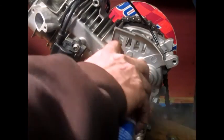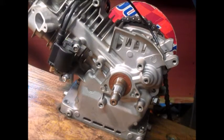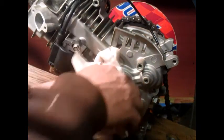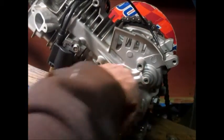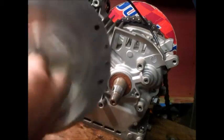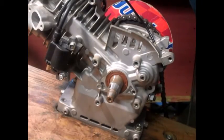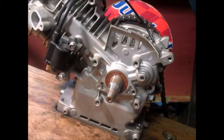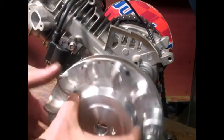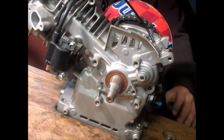So you've got it lapped — now clean it off really well with a nice clean rag. You want to make sure you get all that lapping compound off there. You can see it's shiny — cleaned up pretty well, cleaned inside the flywheel too. Get as much out as you can; you might have to do this process two or three times. No key — get rid of your key. So now I have to go back to the other side to get it back to 36 degrees.